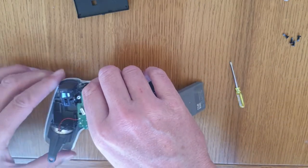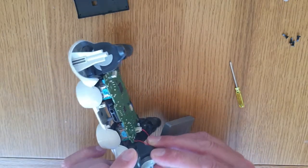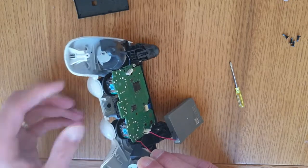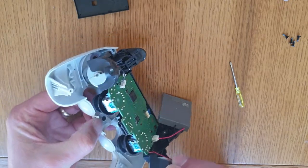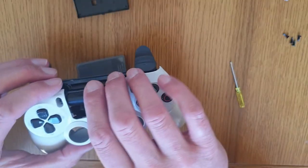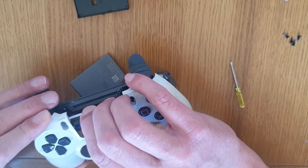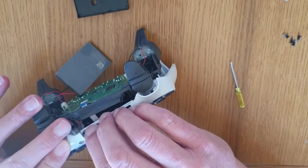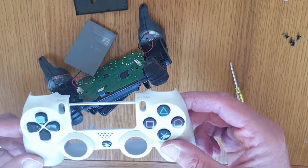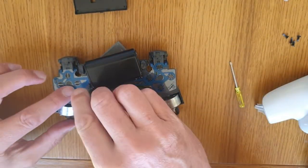Put it to one side. Basically then you've got another couple of clips — there's a clip here, clip here. It's almost the same as the other side, getting the bottom off. You literally clip, clip, clip. This is easy for me because I've already taken it apart. You can then pull this out. The top pad actually hooks over the top of the controller, so you need to push that through there and that will completely release it.